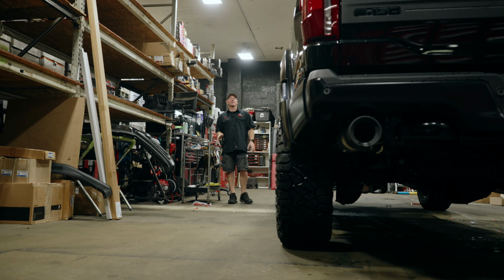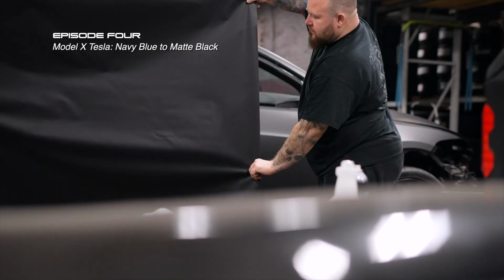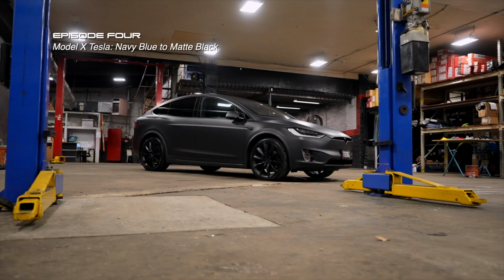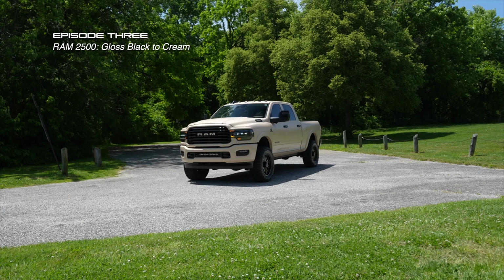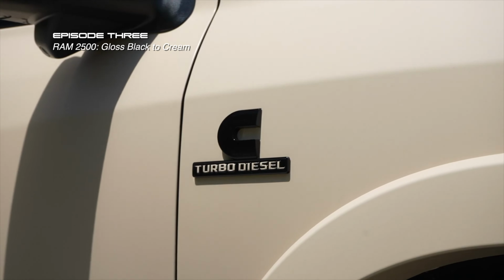All right, so if you've been following us for a while, you've probably seen one of our videos in the past about vehicles that we wrapped. Most of our vehicles follow the same exact process, where we remove everything on the vehicle that can be removed so that everything can be wrapped underneath. For example, all of the handles. You want to make sure that you wrap behind the handle so that when you pull on it, you don't see the original color underneath.